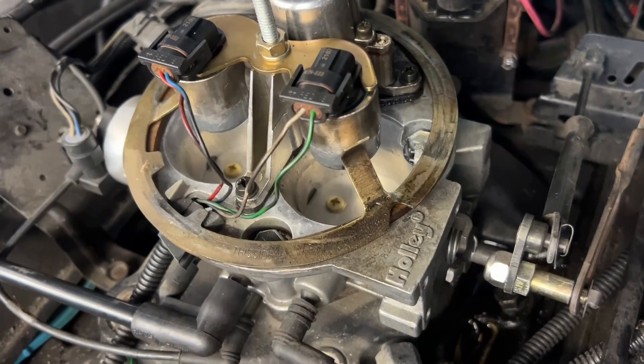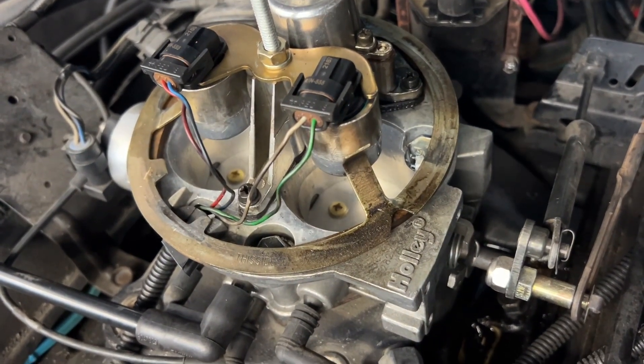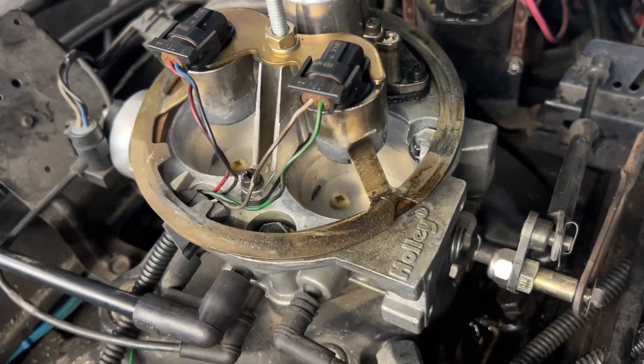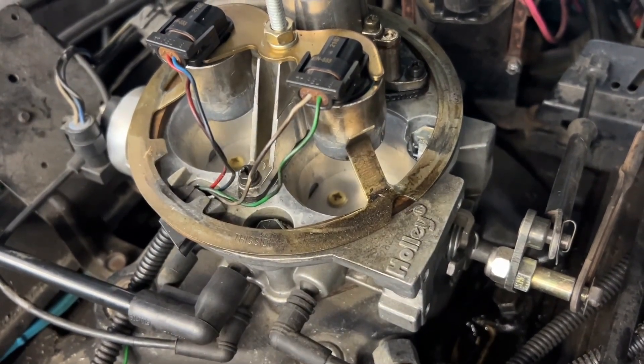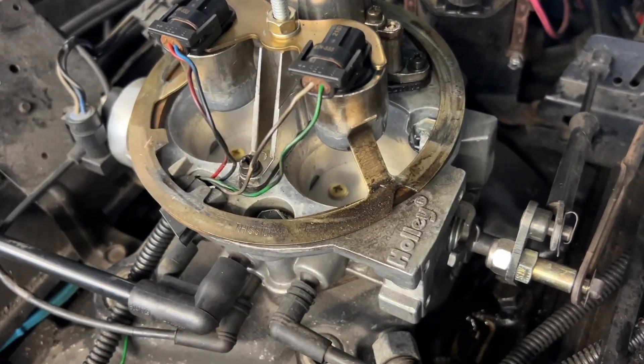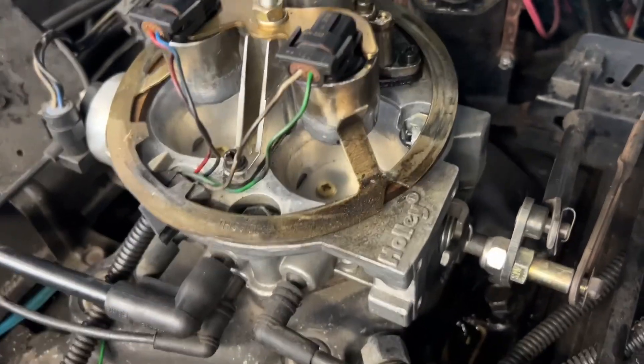And if I advance it, it gets wider and wider until it disappears. Now I'm at 11 and you can see the spray pattern about a quarter inch below the injector — a nice cone of 45 degrees. I can see a nice cone.